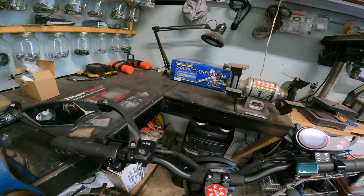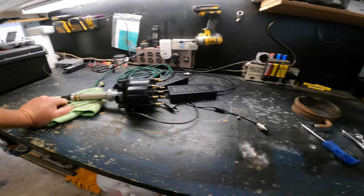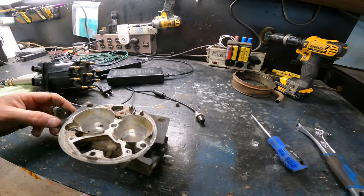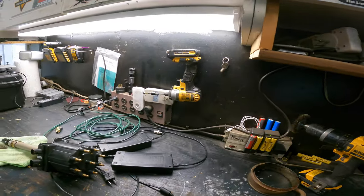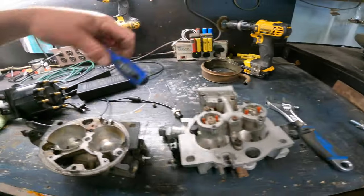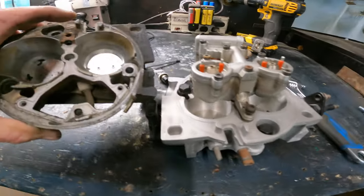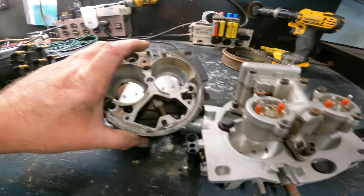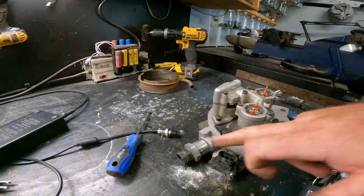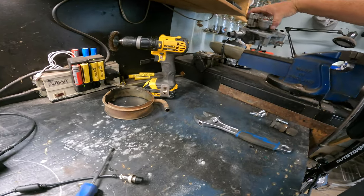We'll get a premium quality one instead - maybe a Holley if you're watching this, Holley, here I am. We're gonna have to clean the spacer up for the throttle body. Here's the old throttle body - I took it apart. I got to get another bolt to hold the throttle positioning sensor. You can see the difference in the ports - you can fit a screwdriver in there pretty good. That's a 750 and that's stock, so we're going with a little bigger holes for this engine. Just gotta order some gaskets for it and clean that up.